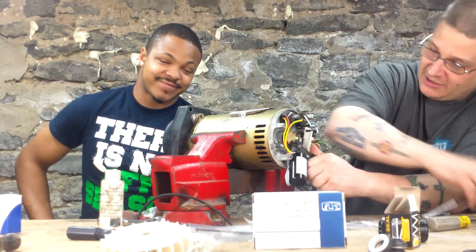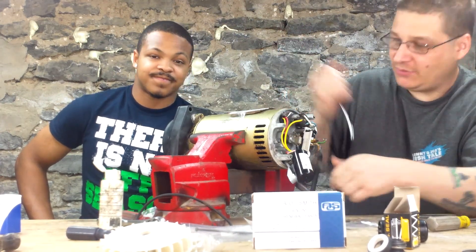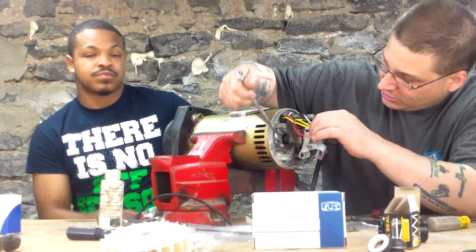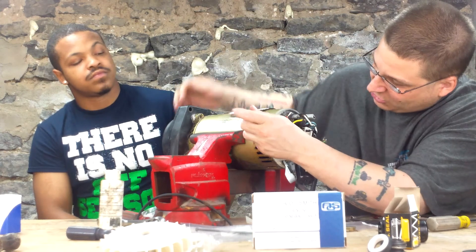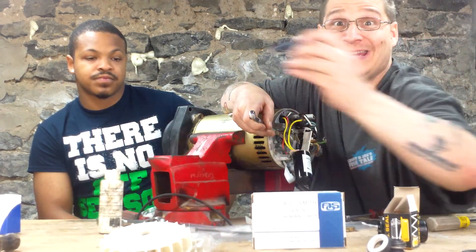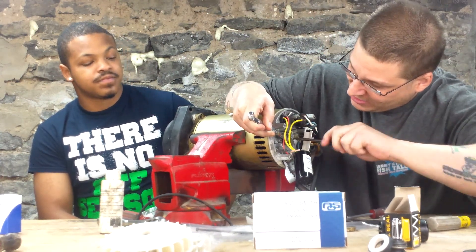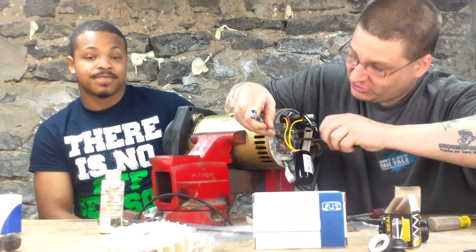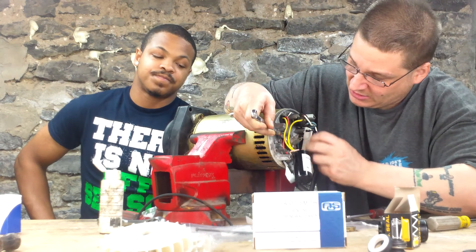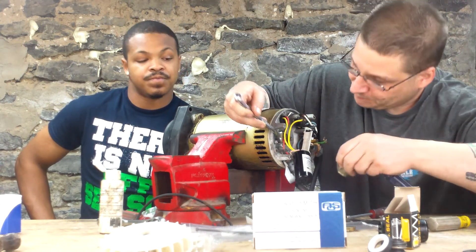The next thing you want to do is get this little piece out of there. I like to use my channel locks and just wedge it out — bam, get that part of the governor out. Next, take a number 12 — 12 millimeter wrench — and get it on the shaft. You'll have to turn the impeller a little to get it stuck right on the shaft. Then take a flat-head screwdriver and remove the center screw. This center screw is a little tight, just take your flat-head and turn the center screw until you remove it. Once you loosen your center screw all the way, you will be able to fully remove your governor.